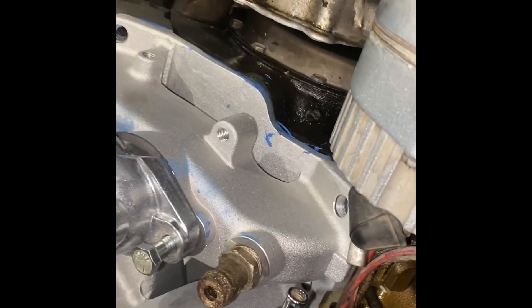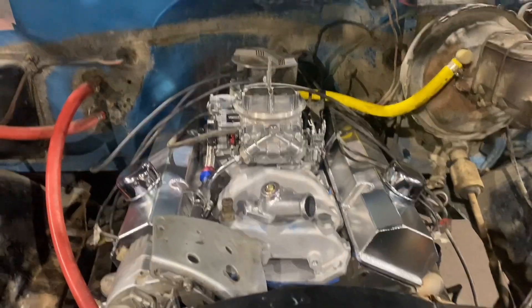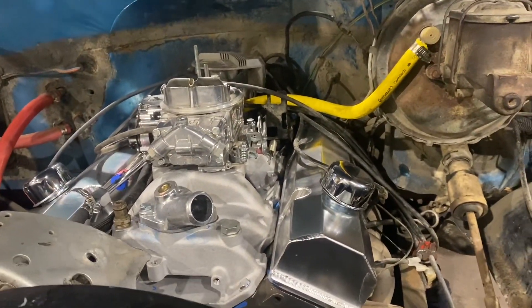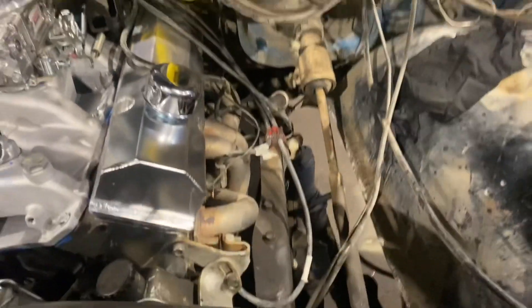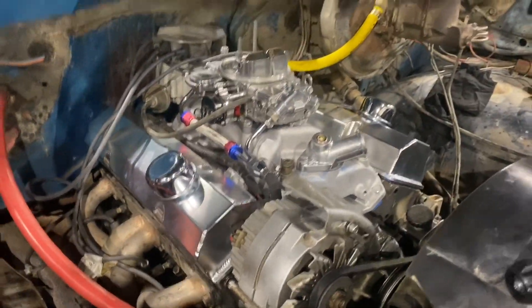She's on — may have had a little mix-up with the RTV there but everything's where it should be, in line, no complaints. Everything's together — carb is plumbed up, vacuum lines are on, all the spark plug leads are on, and the valve covers are buttoned down and tightened in that crisscross pattern.